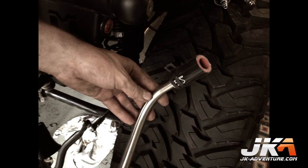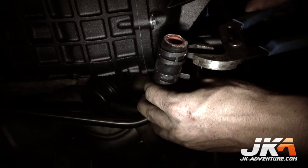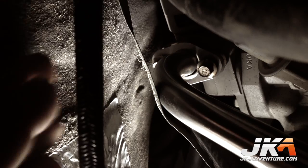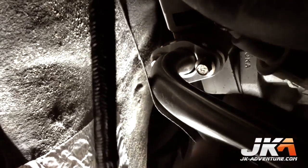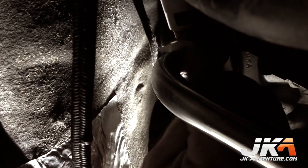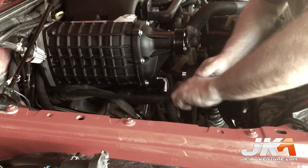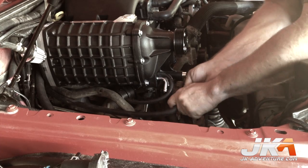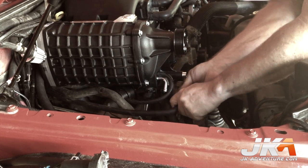Here is a shot of the EGR tube with the provided hose section installed. Connect it with a spring clamp to the remaining hose barb on the bottom of the supercharger, then connect the other end to the valve on the passenger side using the supplied gasket. This is much easier to access — and really only possible to see clearly — if you remove the fender liners. Connect the free end of the hose attached to the brake booster to the inside hose barb on the bottom of the supercharger on the passenger side.